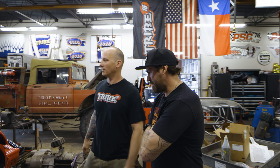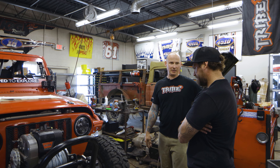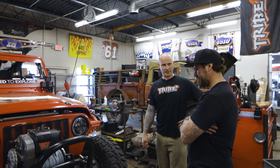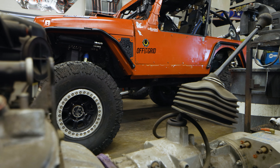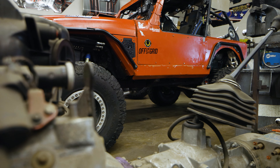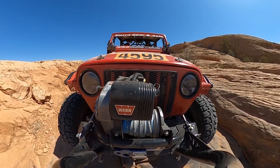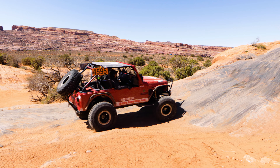Why don't we do a quick walk-around and tell me what you guys have been working on. In our race prep we look at the major key points — the suspension, the brakes. Right off the bat we found that the brakes were really worn; the rotors were really worn and the pads were a little thin. That's a quick easy one — it's a consumable item. Instead of building something new, you're buying a car that's got some miles underneath it, so a lot of bugs have been worked out. It's proven and it performs. We found some plumbing issues that we rearranged and moved some stuff around — it's been raced a bunch and the car works, so it's just small tweaks.